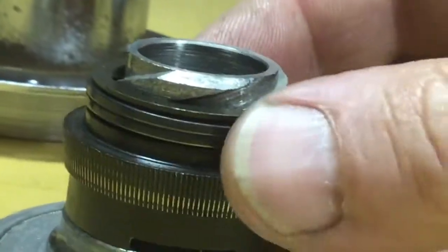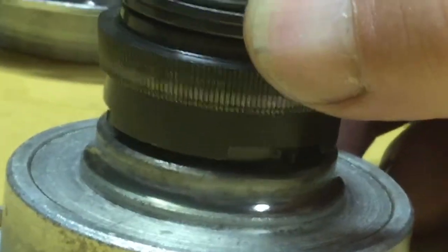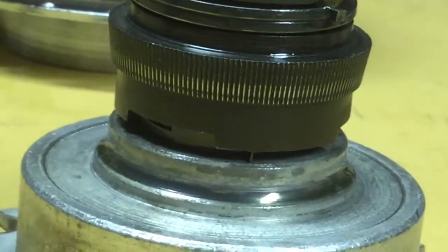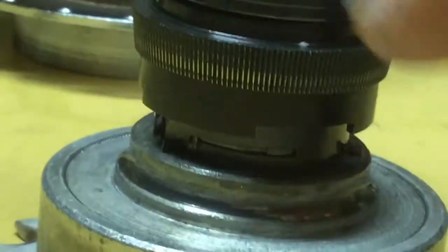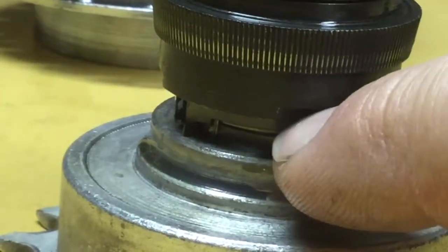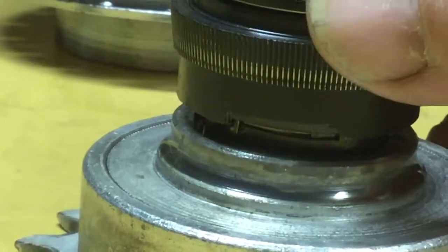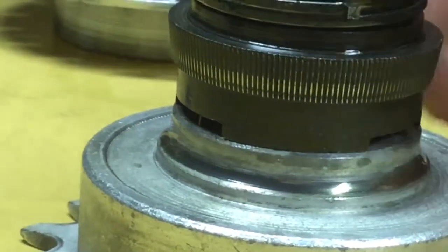You can hear the ratchet action. It works just like the ratchet in a clock — there it drives it forward, there it ratchets back. So we are in the locked-out position, so we are in low speed. It advances it forward. This is the direction that the parts would move relative to each other if we were back pedaling — that's how it advances the sequencer, during the backward motion of the pedals. Then when you go forward again, it ratchets, and there we go — we are in high speed.